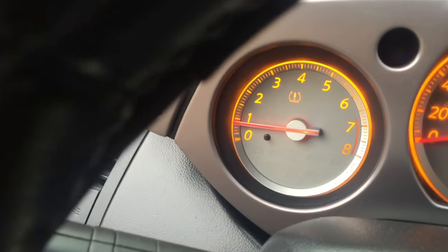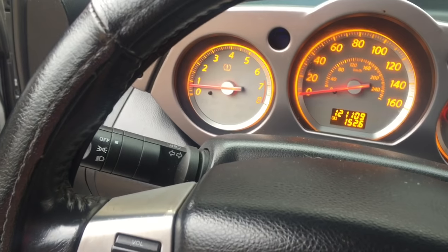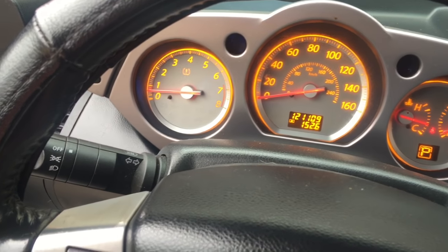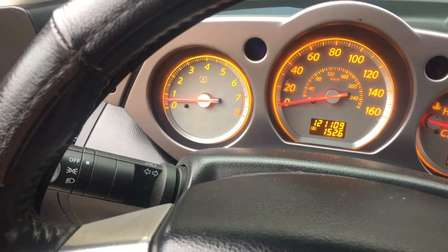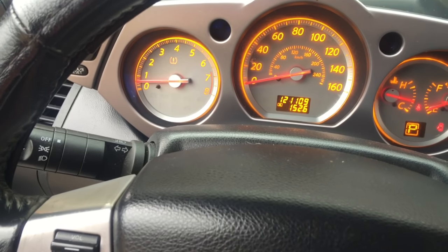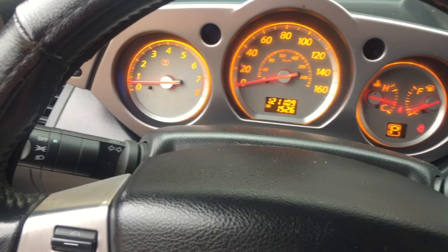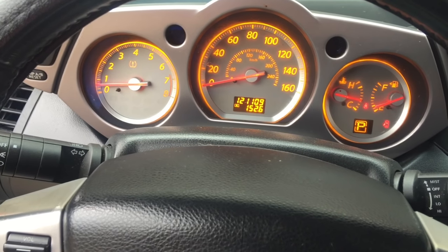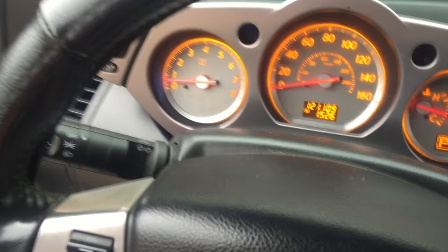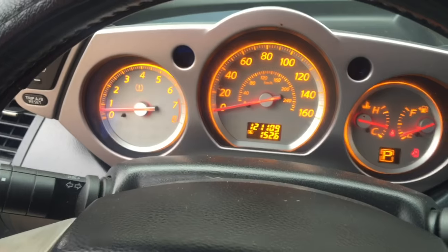Regular idle RPMs on this vehicle are a little bit above 500 — you'll see it drop down after the car idles for a bit. At the beginning, after we cleaned the throttle body and removed the intake and did some other work, the RPMs were above a thousand, probably about 1200, so that's why we're getting the code. Now I'm going to show you guys how to do the throttle position relearn, or throttle air intake relearn.